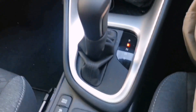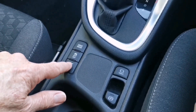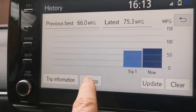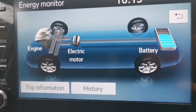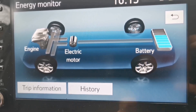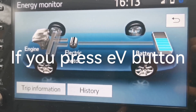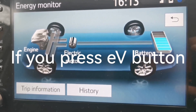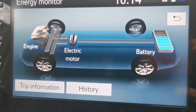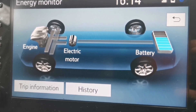So that's all it's for. It's not for pressing when you decide you want to run on EV — it's purely just there to stop the engine firing up when it's cold. I hope that's helped. Just to finish though, I'd like to say that if you've come home on battery only for your last five or ten minutes and the battery is a little bit lower, it may be that next morning it will fire up simply because there's not enough charge in the battery — the system doesn't like the battery to run too low.